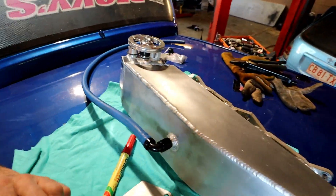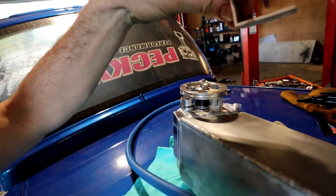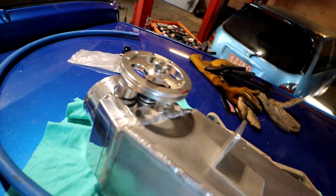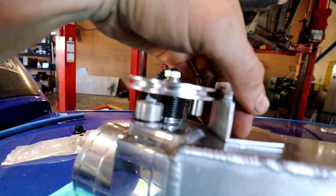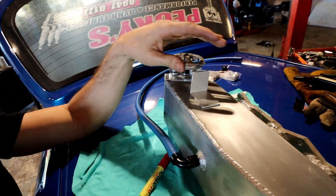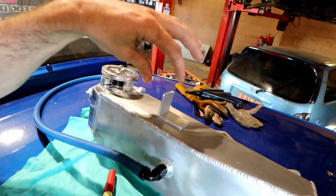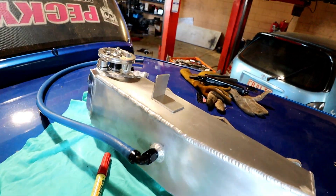We're all welded up and ready to go and then we realised we haven't put the accelerator bracket on yet. We've got one here that we thought we can weld on there. We've worked out where the cable hole has to go, but now we don't actually know where the cable has to mount to. So we've got to mount the manifold onto the car, mount the cable onto this bracket, set it all up where it's going to go. That way we can get a perfect adjustment, mark it, weld it on, and then the intake manifold is ready to go on.